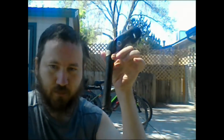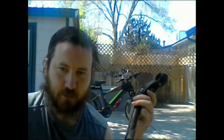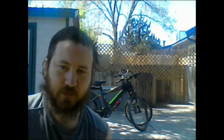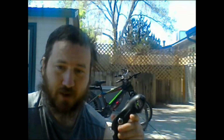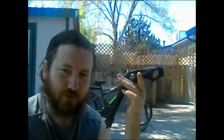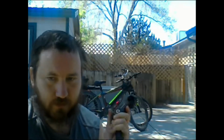And also, you have the wedge tool, so you just slide it in, instead of a threadless system, which has to rely on keeping the stem itself, aka this piece, on the bike. If that doesn't happen and your little cap top ends up falling off or is too loose, your entire fork just, and there you go. Compared to a threaded system, if this gets loose, you have no issue with your wheel falling off. Sure, the angle of this is going to go off, but you have that ability.